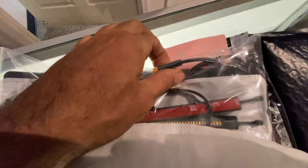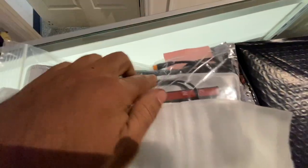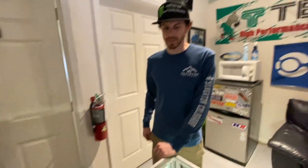Yeah, so a lot of guys are always a little bit scared to do wiring, you know? And that's obviously a safety concern as well. Exactly. These plugs look like they're all weather packed. Very waterproof. They're pretty standard e-bike plugs. They're called the Julet. You'll see those a lot on the ASI kits, a lot on the displays for ERT, I think the Bafang also. It's just a really compact, waterproof plug that's easy to manage, easy to plug in.